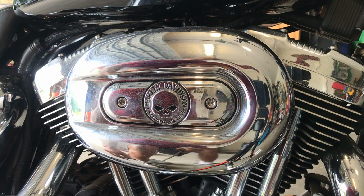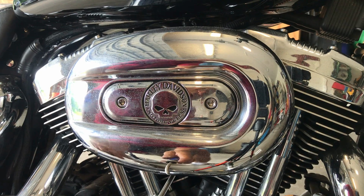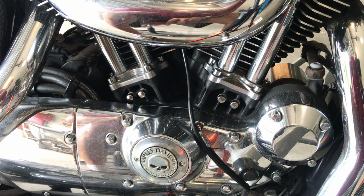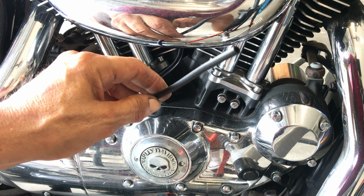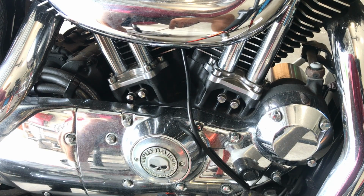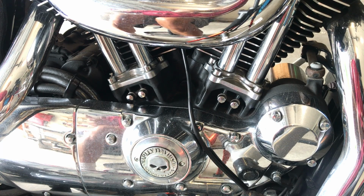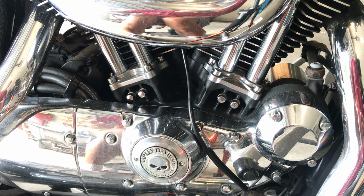You will see there will be a hose that comes off the bottom of your carburetor. This is it right here. So if you got gas coming out of this hose, you need to replace or clean the needle jet on your float. And with that, I'm going to try to explain how to remove the pin without damaging the carburetor and what to do to clean the seat and the needle jet or just replace it.